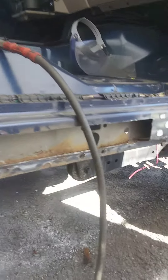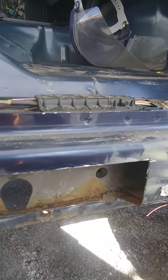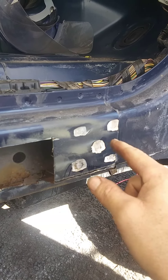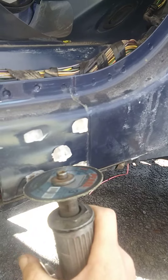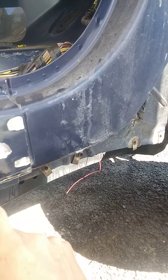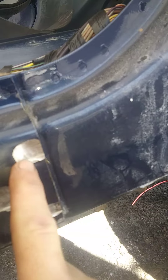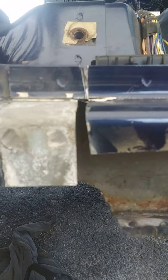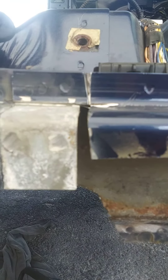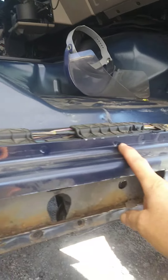I want to show you a little trick on getting rid of spot welds. I do want to save this piece to weld onto, so I don't want to drill through it. What I've been doing is I just use my cutoff wheel and use it as a grinder — basically like this. As you can see, as you go down, the spot welds start to come out. You'll see the little circles, and if not, they just need a little bit more grinding. I'm gonna cut this lip off and then slowly grind all these off.